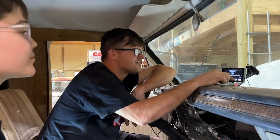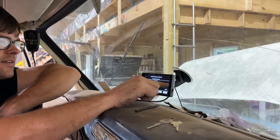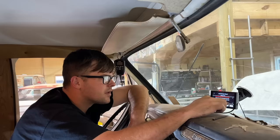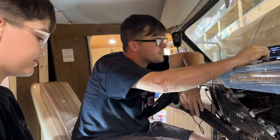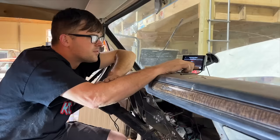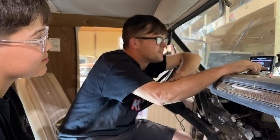Target idle. We want more than 400, probably like 800. Yeah, we'll go with 800. Oh, okay. Quit making fun of me. Cam specs, we're definitely below 235. Ignition type, Holley dual sync. Fuel pressure, what is our fuel pressure? Usually 40 something? Is it 43 or 60? I think it's 40. All right, we'll go with 43. No, it's got Excel injectors in it. Super simple setup. It's got 30 pounders, no nitrous, supercharger, turbo, internal one bar, map sensor, drive-by-wire, no.